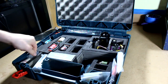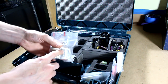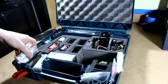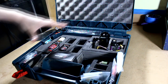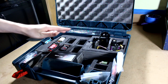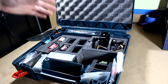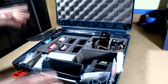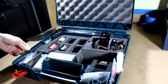Over here we have some oils — got comm cutting fluid and some bearing oil, because when you're servicing a motor you should oil the bearings. This whole case is designed so that you could take it anywhere and have everything you need to cut a comm. You could take it to the racetrack, you could take it to the crawler course, you could take it to the top of a mountain. You could take it anywhere you might need to turn a comm — that was the idea, because there are so many little tools you need for comm cutting that I figured they'd be better in one place.